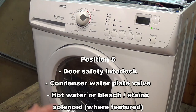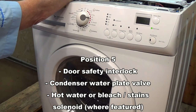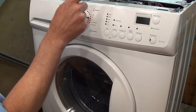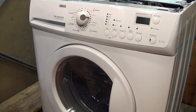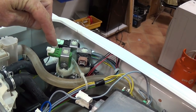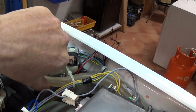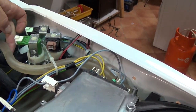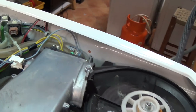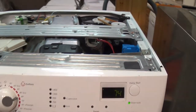The next one on washer-dryers is the valve that trickles water through to the condenser on the dryer side — that's showing the valve is functioning correctly. You can see all three water valves on the first three tests. With this water valve activated, if I lift this you can see the bubble in the pipe, so water is flowing down to the condenser on this side — that's only for the drying function.